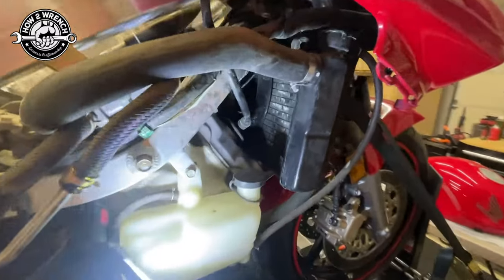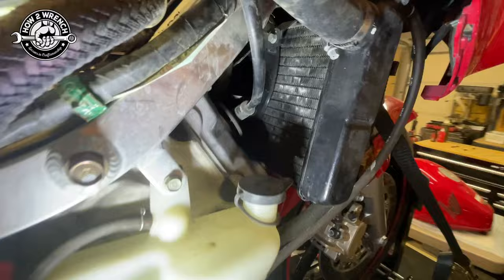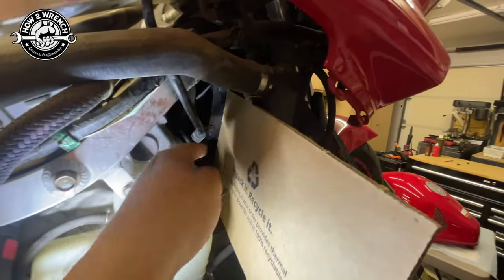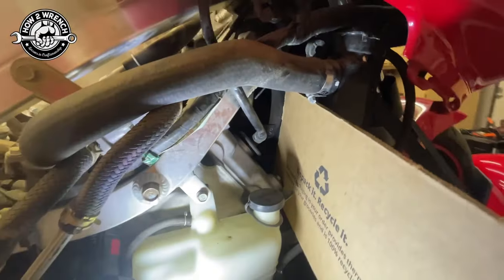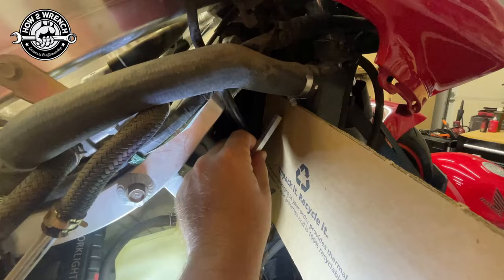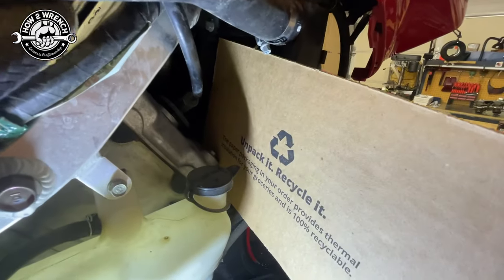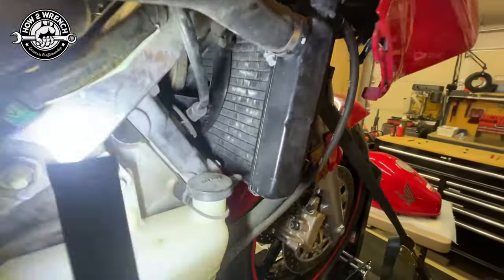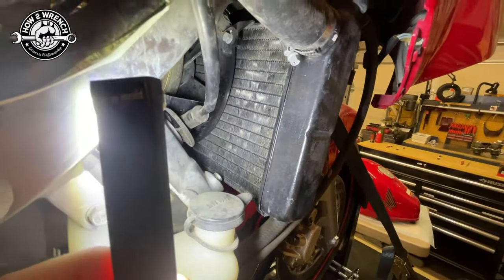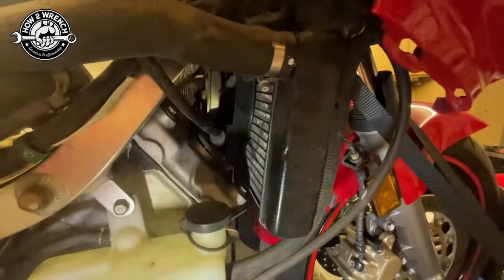Here's an even bigger pro tip: if you're working on a bike that was mint condition and you're really concerned about protecting it, just take a little piece of cardboard and stuff it in there. You could even cut around it if you want to go further, but that way if you do accidentally tap or touch the radiator, you're not going to scratch any paint or have any problems at all. They do make tools to straighten fins, but on something like this, if you cause that damage you're most likely pulling the radiator and painting it — a lot of work. These are pro tips to protect yourself ahead of time.